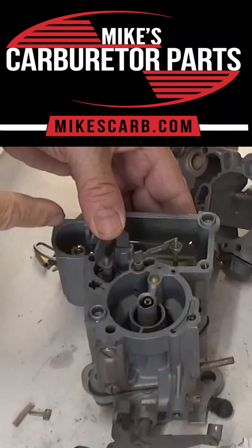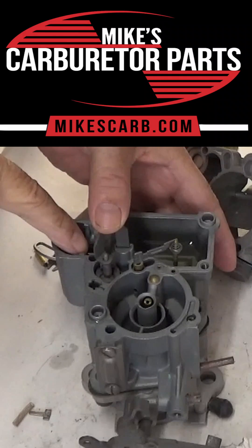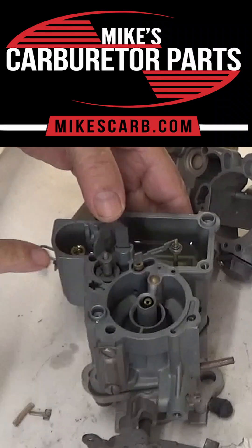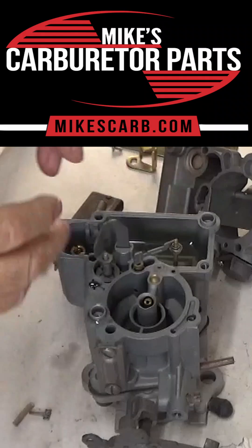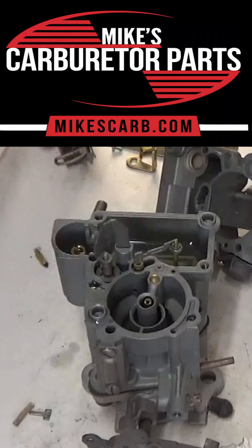As you can see, it's filled up. This one doesn't need an intake check ball — it just kind of bleeds over into the pump well. So I got the check ball out of it, and as you can see it will pump fluid through here, so we know that circuit is open.